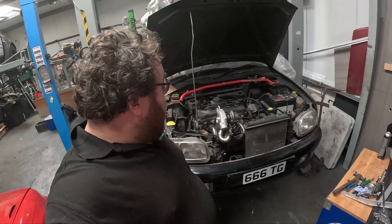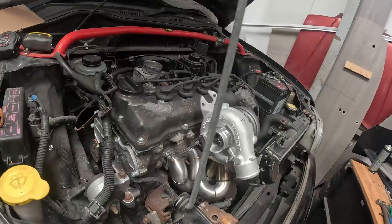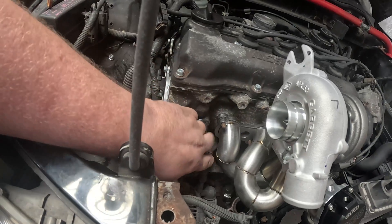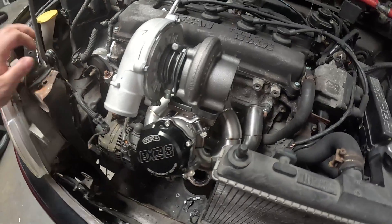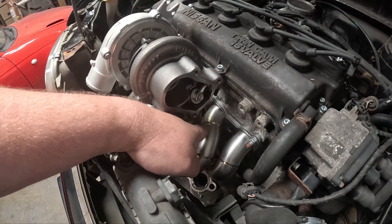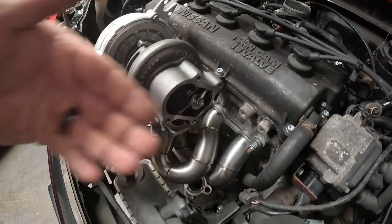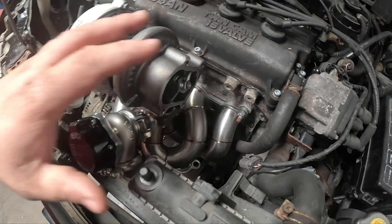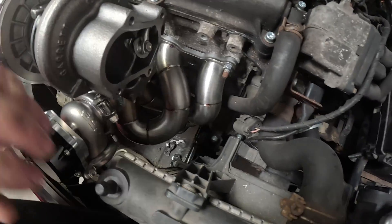The manifold is all tacked up and ready for a nice deep welding session. I've removed it from the fixture and placed it on the engine on the car just to make sure I've got no clearance issues. I've got a nice gap between the first primary and the alternator bracket. We also had to dodge a little pipe which comes underneath cylinders three and four for the PCV breather to the rocker cover. I've had to bring the runners sweeping outwards to clear that pipe, but we have a good air gap between the manifold and that pipe. That has caused a secondary issue which we'll tackle in the next video — and that is the downpipe.